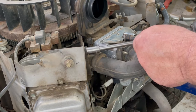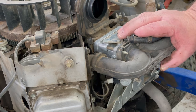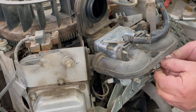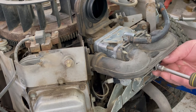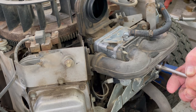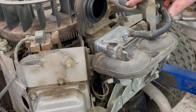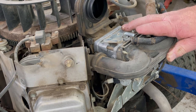I'm going to tighten them all up and then put the carburetor back on the engine. Hook the governor linkage up first. Make sure these orange rubber gaskets are intact on both sides — if there's a crack or whatever, replace them, because air will suck in there and it won't run right. I'm going to hook up that solenoid right away so I don't forget about it, then hook the choke cable back up. I'm going to replace this fuel line — it's not cracked but it's really hard. And the little vent hose on the back, just press it back in there. I'm going to put new spark plugs in it, change the oil, and inspect the belts. I've got to take the gas tank off and clean it.